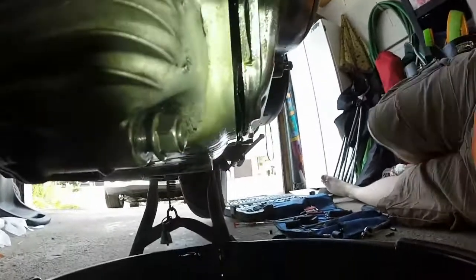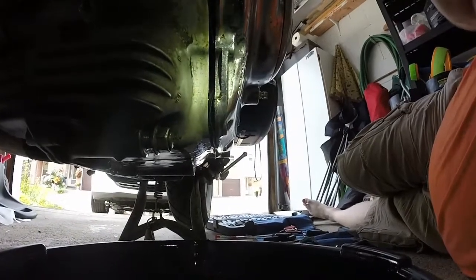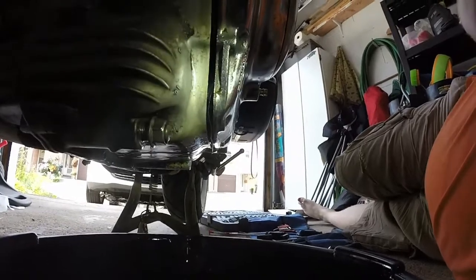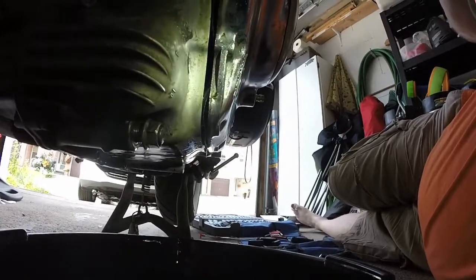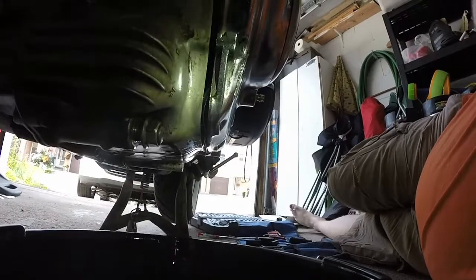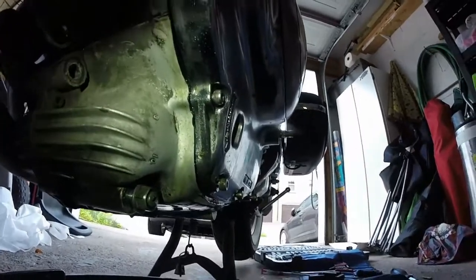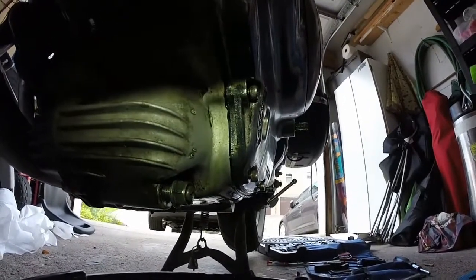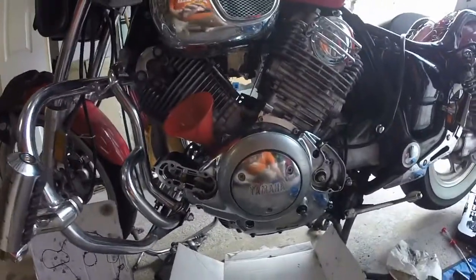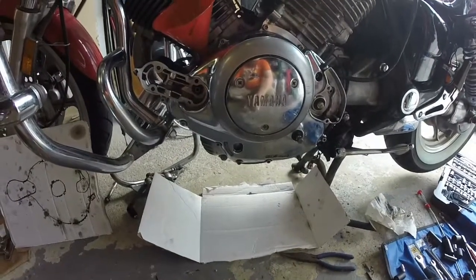My leak is coming from in here. What's happened is the gasket got twisted somehow and I can't just pull it back into place. I'm going to have to figure out if I can get something in there, like a butter knife, just to fold it flat and press it back together tightly. I haven't taken the whole gasket right back off, but I did have to re-drain the oil. I've got a fairly decent view of the gasket now. When I looked under before I just saw metal against metal, so I think it had got folded and pushed in. I haven't poured all the oil back in yet - I want to see if it holds first. I've got a piece of white cardboard underneath, so we just wait and see if we have a drip.